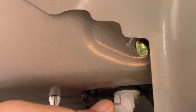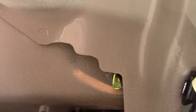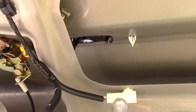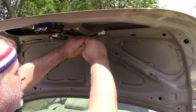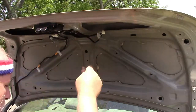You come up in here — these are the bulbs right here. There are some other connectors you may have, but these are it, and these take a twist one way or the other. That one came out like that, and this one comes out like that. There is the original bulb that can come out. Now we have to remove the bulb from the socket — these should just pull right out. If you can't get them, you can use something like a pair of pliers, but you want to be careful not to break the glass.